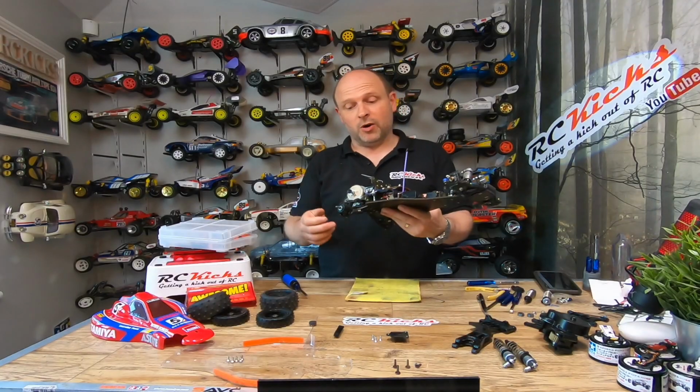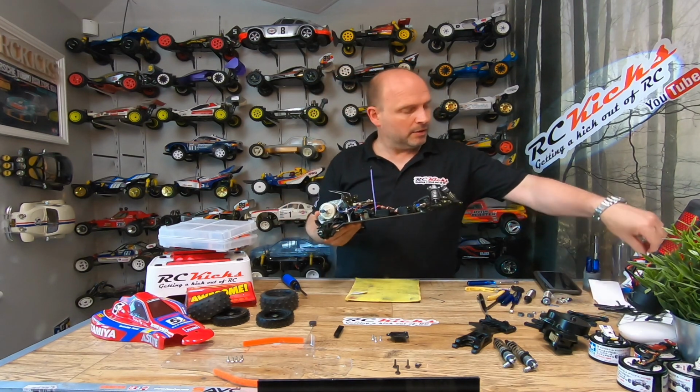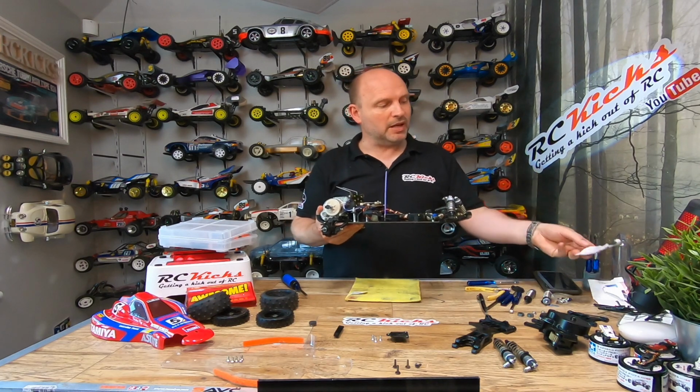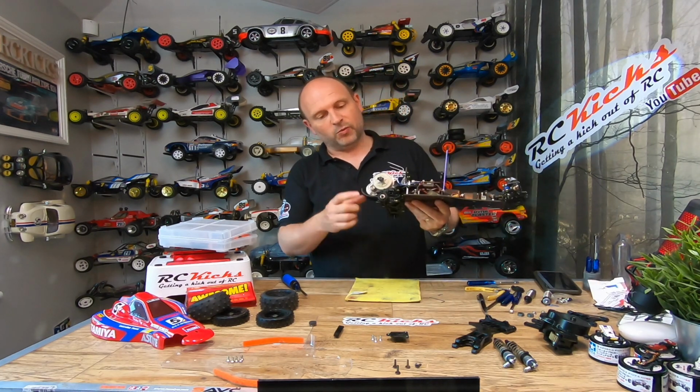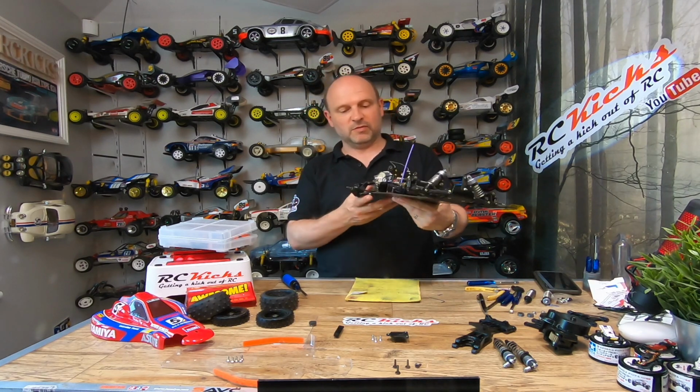Well, it's taken me a while, but I've managed to get the gearbox in and I moved over the motor. I needed a different pinion, but luckily in my pinion box I happened to find a Schumacher, 24 tooth 48 DP that fit and worked. So that was a bit of luck. All went back in okay, no too much of a problem.